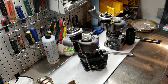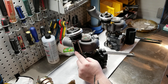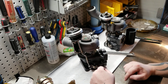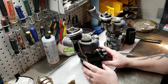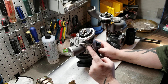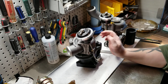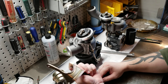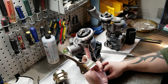Now that you see how it looks and what it takes — for this one definitely make sure to put a little corner in there. Put some extra welding on the inside, or just take a rod and burn it up towards the center, keep adding on and adding on. If you can't weld or don't have welding equipment, instead of using 1/8 inch, use a quarter inch. A quarter inch should be strong enough where you don't need any reinforcement gussets to keep it from flexing. You just have to heat it up to do the bends.